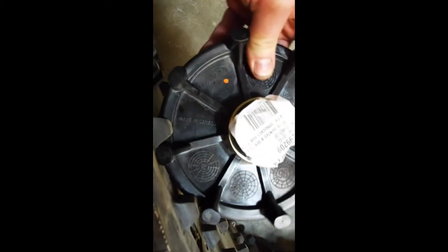Okay, so here's the wheels we're gonna put on. I've showed this before, but there it is again. So it's got the 2.52 pitch, and this is the track I'm gonna put on. It's from a Skidoo. It's not the best of shape, but there's still plenty of life left in it. I can always swap it out later if need be, but this is a clip every third window. So it looks like a pretty good track.